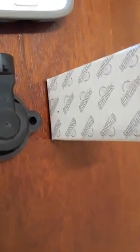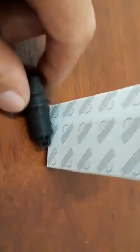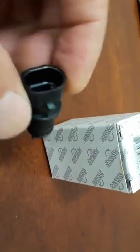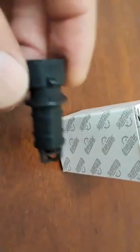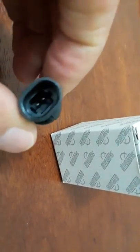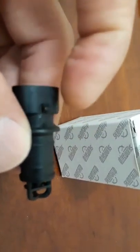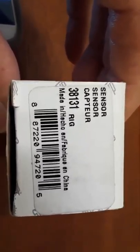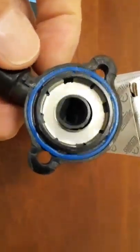The other problem I was having was with the intake sensor, which is this right here. These two pieces don't need any tools — it just snaps right in. You undo the plug, unplug it carefully. You see where it has a tab where you lift up to unplug it. This is the part number for that and they're relatively cheap — I think it was about $19 at Advanced Auto Parts. These are not AC Delco parts but they do work.